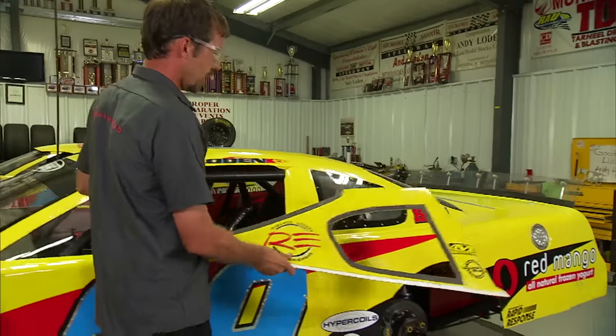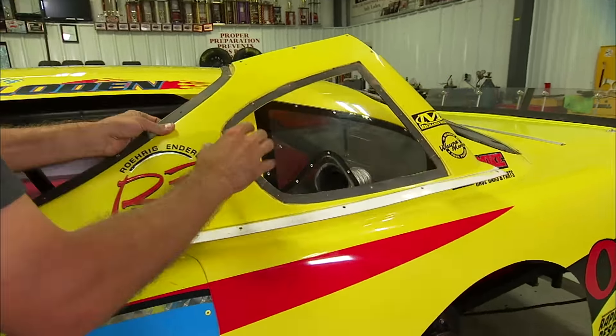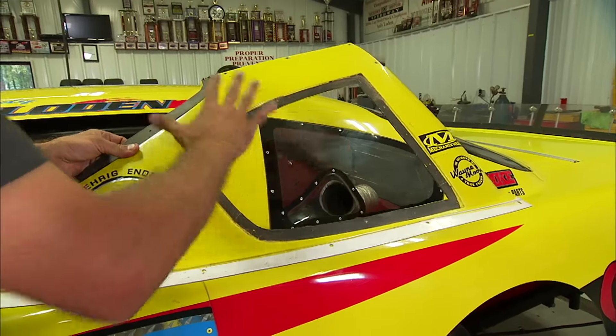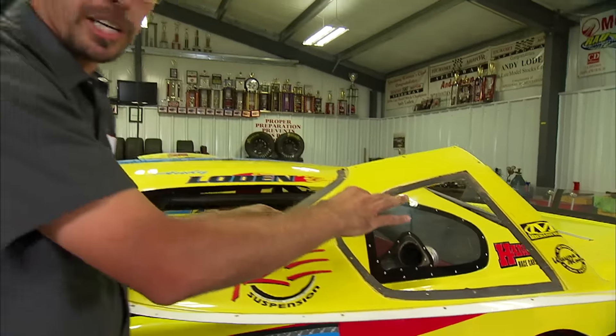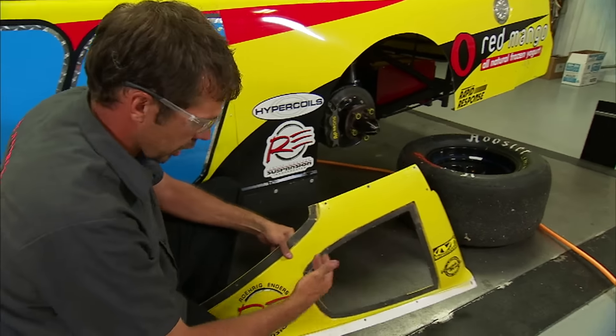One of those applications is right here. This is the right side — a quarter window. It's got the B post and C post, and this panel right here comes fully enclosed. You need to come in and cut it out. That's why teams will refer to that 429G reciprocating saw, because it allows you to cut multiple angles and contours.